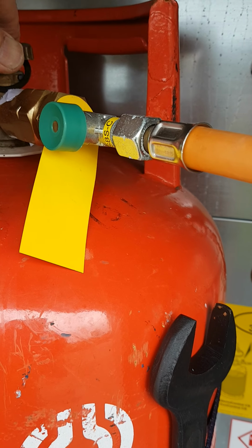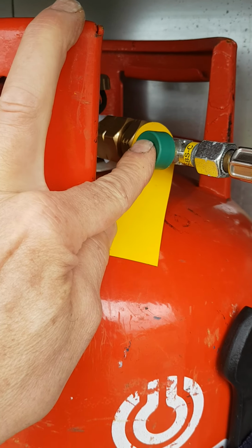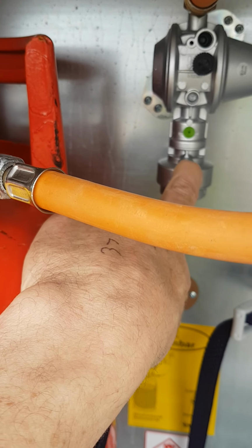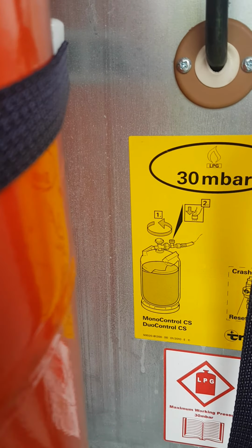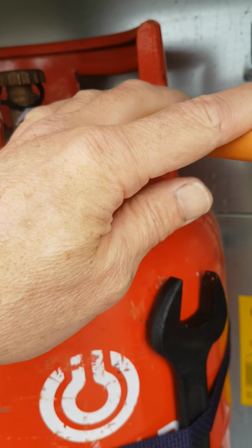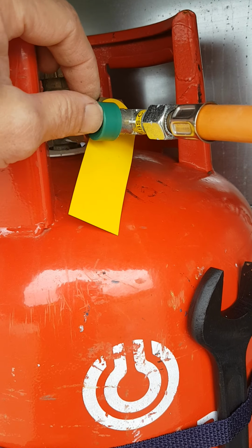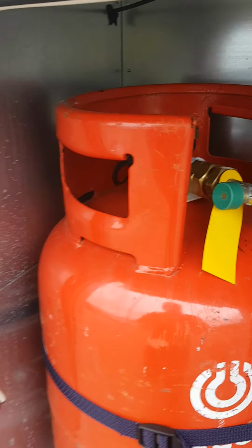So when you turn on your gas, just give that button a little press for 2 or 3 seconds, and you have a little one here on the regulator itself. It shows you down here your pusher button. Generally it's alright if you change the gas bottle. If the pressure drops on the van side of this regulator, that button will trip out, so you'll have to push that in. It's just a habit to push that in.